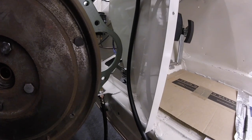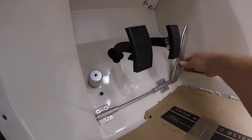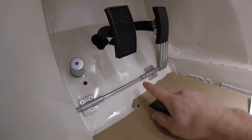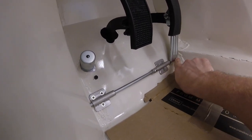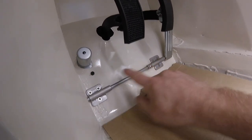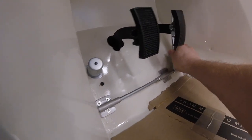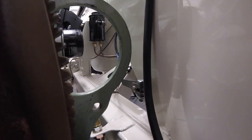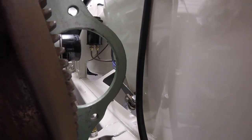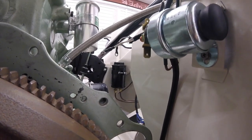We're down in the footwell — today is going to be a little bit trickier to film than I thought because we've got an engine in the way. This is the original standard pedal, pedal bracket and pedal bar. All we've done is put a stopper on there because if you're putting your foot down there's a potential for the pedal to work its way out and start hitting the body. We've cut a little bit off the bracket to make it a little bit longer, put a grub screw in it, and that will stop it moving over that way. That pushing pedal action with the lever will translate — as you push the pedal down the lever goes down — so it's going to pick up on that clevis, and the bracket is probably going to go somewhere up here. Let's get the cable in, get the bracket in, and then mark up and get some holes drilled.